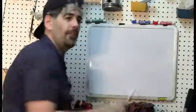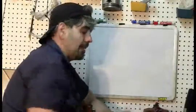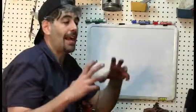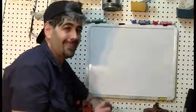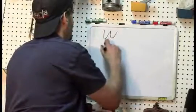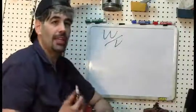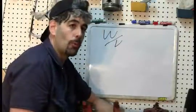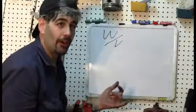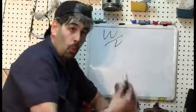All right. Welcome to the DBOC, the Dry Erase Board of Knowledge. So what is the IAT, the intake air temperature sensor, and why is it important? It is important because in order to create the exact correct amount of air-fuel mixture, the engine has to know the density of the air, or the weight of the air per volume of the air. And this is done by using the intake air temperature sensor because colder air is actually more dense than warmer air. So for the same volume of air, say a gallon of air, if the air is colder, it would actually weigh more than that same gallon with warmer air.